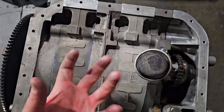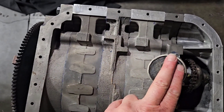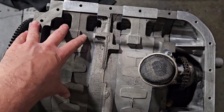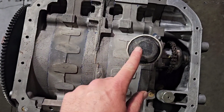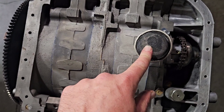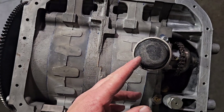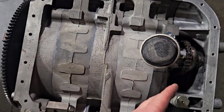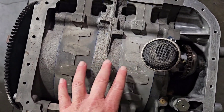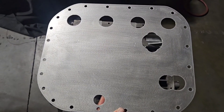You've got all this oil spilling back down into the pan, and if you turn or corner hard, that oil — instead of staying in the pan getting picked up into the pickup tube — will go back up into those cavities that should be drained, thereby lowering the oil amount in the pan and causing starvation of the pickup tube. The pickup tube needs to stay under oil to allow for proper, continuous pumping. If you start to suck some air and get cavitation, that can lead to a really quick drop in oil pressure, leading to engine bearing failure or internal problems in general.